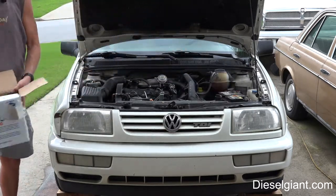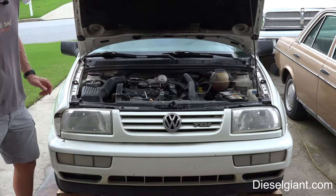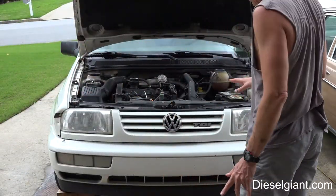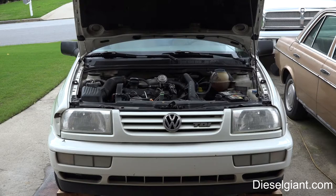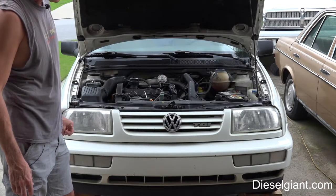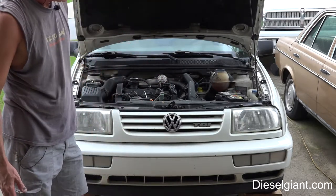It's amazing — this engine is a 1.9 liter and it holds nearly six quarts of oil. I usually put five in there to begin with. Before I start it up I'm going to go ahead and do some degreasing on the underside of the engine. This car, since it was new, has dripped oil from the PCV area — bad design by Volkswagen. Over time it drips on the valve cover, runs down, and just makes a mess, so I'm going to clean that up and then start it up.